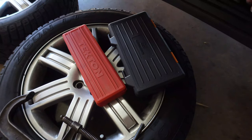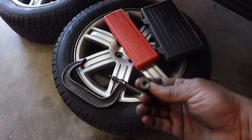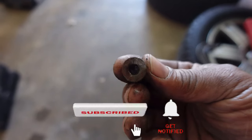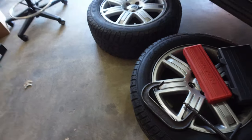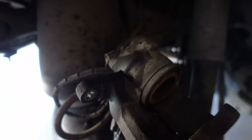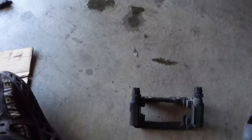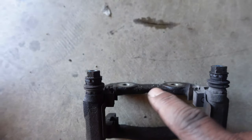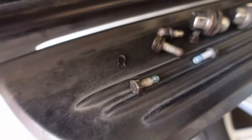Now you're going to need some tools - you're going to need a five-eighths for the caliper bracket bolts, the big ones. The smaller ones are the caliper itself bolts. Also this little thing here is what holds the brake rotor on. I'm gonna show you all this stuff assembled on the other side - I'm just showing you one side broken down. You'll also definitely need a C-clamp. The back is very similar except the back only has one piston, just two bolts to hold the caliper in place and then two bolts to hold the bracket on.